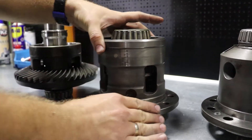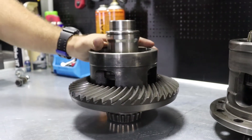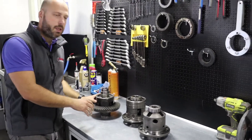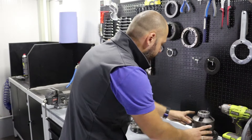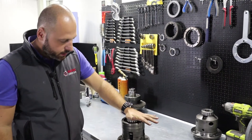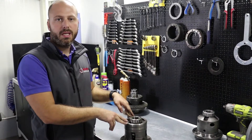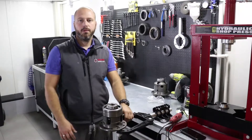And after we finish with this one, today we will move on to M4, the latest generation of active differential. To disassemble it and show you internals and our clutch upgrade packs. We can leave this aside and show you what is inside of this one and our latest clutch pack — to transform it from visco clutch type LSD unit to purely mechanical clutch type LSD unit.